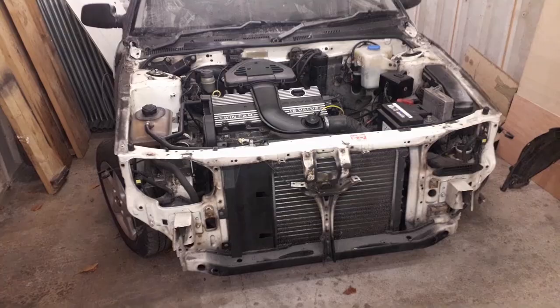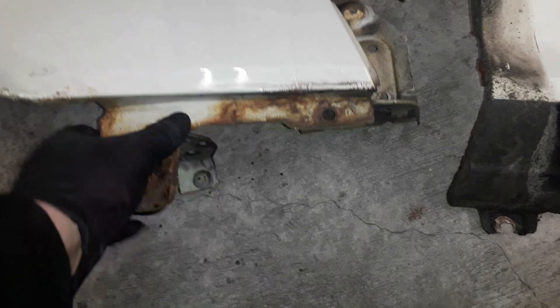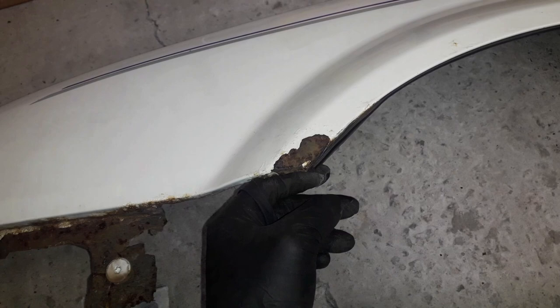Dinner has been and gone, and the wings and bonnet are also gone. Let's have a look at these wings. As you saw before in the other video, there's a bit of corrosion on the offside front wing where the bumper mounts to it — hopefully that can be salvageable, and I think it can be, but I'm not too sure without digging a bit deeper. This is the near side wing, and as we were removing it you can see it's fully rotten on that bumper mount. There's rust here but the metal seems pretty intact — again, without further investigation we'll see what it's like.